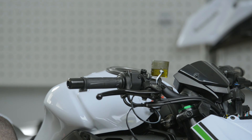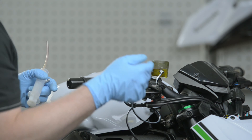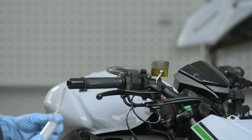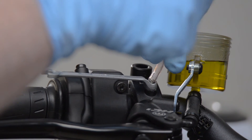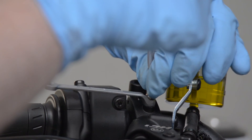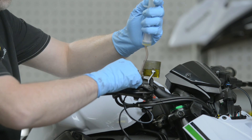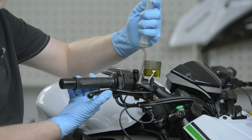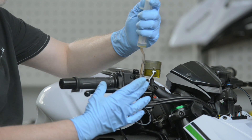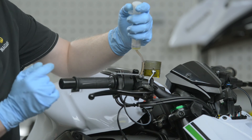In order to expel the air from here, there are different ways of doing it. You can simply open the bleed valve, put a bit of paper on here, and activate the lever. The best way I find is again with a syringe and a soft hose. In this case I use a 6mm spanner on the bleed nipple. Again I create a vacuum in the syringe so that the air travels up. If I then activate the lever, I get the last bit of air out. When the fluid comes clear with no more air in it, I simply close the bleed nipple again. 2 Newton meters, by the way, for the bleed nipple — it's very small.